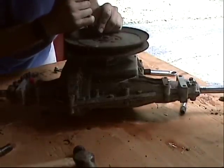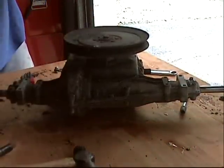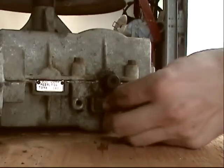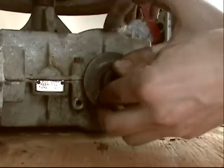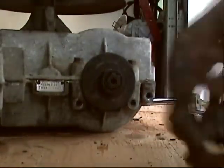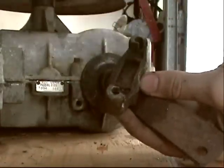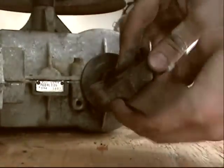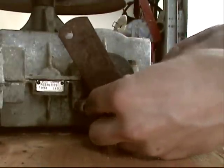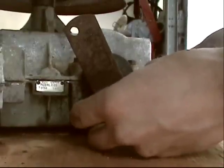Make sure that's in there. Yep, that's in there. Snap ring's in. Just pop the shoe in the little hole. Push the disc on until it stops. Here's the brake caliper — this thing's easy. It's just held on with two screws. It just goes on just like that.